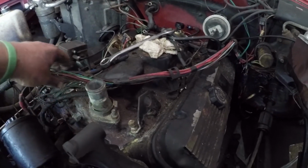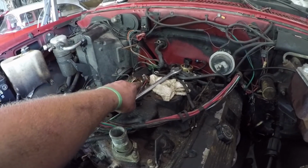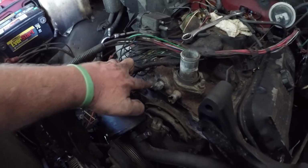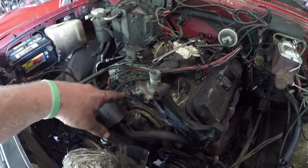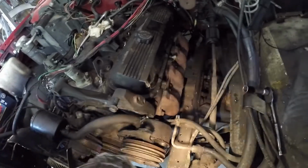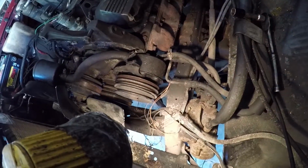Then they run, not all the wires, but some of them run back. Like these are your injector wires that go into your throttle body. You got one wire that hooks here. We got to put the hose onto the water pump before we get too far in, because you won't be able to get to that. One of the wires in this gob runs way down here beside the manifold and the power steering bracket. There's a sensor. You can see the 3-4 wires right there. That's off the old sensor, but there's another set of wires that's actually on the harness that goes down there.